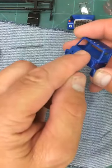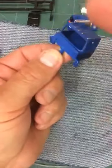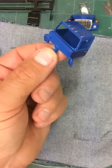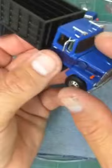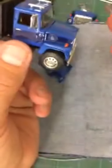Or you could do what I'm going to do on this one. I know at some point there's going to be another windshield come around, so I'm just going to let this chill out without a windshield, because we can weasel one in right through that window and then wallow it in there with some tools. Won't be easy, but then we'll have a good windshield. And I noticed one thing on this one this morning, that I didn't use any glue on it. And there was some other extemporaneous plastic on it that I cut off too, just so it would go in easy. And it's just sitting in there, all chilling out. And it went in really, really simple. So I think a guy could hope and pray that someday an aftermarket windshield comes around. Maybe somebody has a junk truck or a broken one. They'll give you a windshield, and then you just put it in down the road. Because sitting on a shelf, you probably won't notice it.